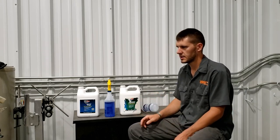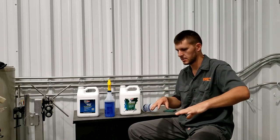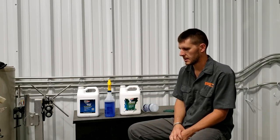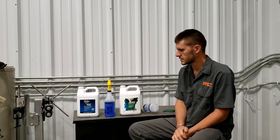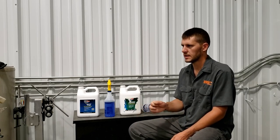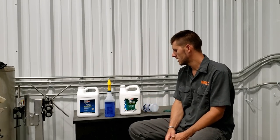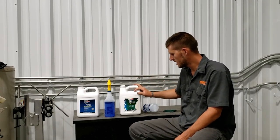My process was, I sandblasted the frame, did my welding, took a flap disc, 80 grit, and flattened out my welds. And relative to the sandblasted material, the flap disc left a real glass smooth surface. And so I wasn't happy with that. And I tried different grits. I took an air powered flap disc to it, like 36 grit, and I still wasn't happy with it. So I actually took my own sandblaster and just spot blasted all the areas where I had used a flap disc, and that abraded the surface really well. And then washed it down with this.